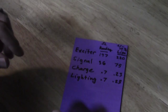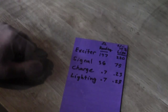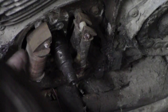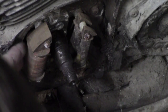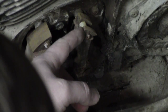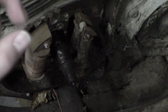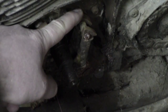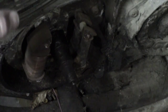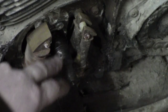Here's the bike I took the flywheel off of because it was missing one. To explain: this large coil is the lighting and charging coil. Over here, this smaller outside one is the signal coil — think of it like the contact breakers on a breaker point system. It creates a small voltage that goes to the CDI box and tells it when to fire. The other one is the exciter coil, which creates the voltage that is then sent to the ignition coil to be stepped up and fire the spark plug. Both of those are currently out of spec on the main bike.